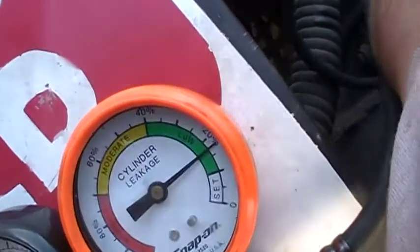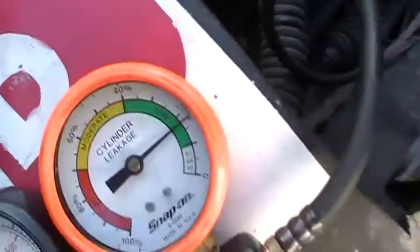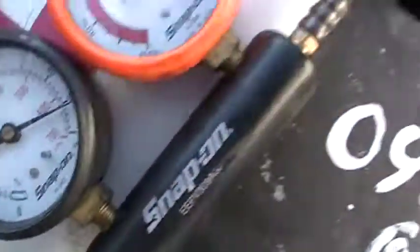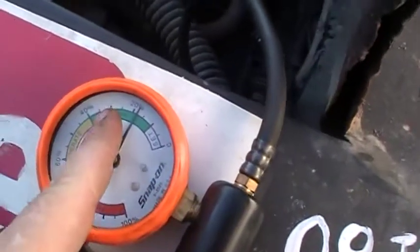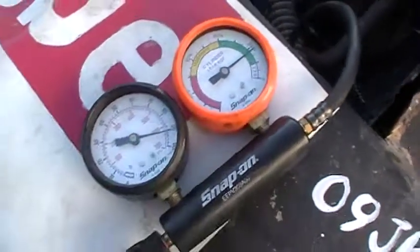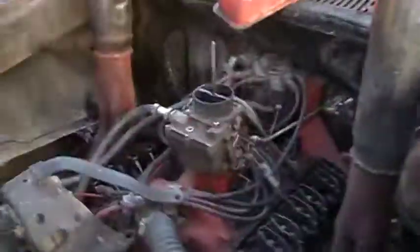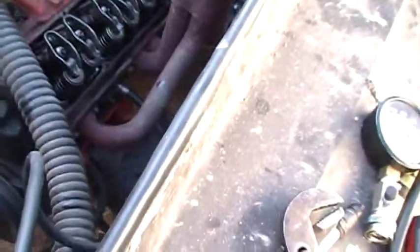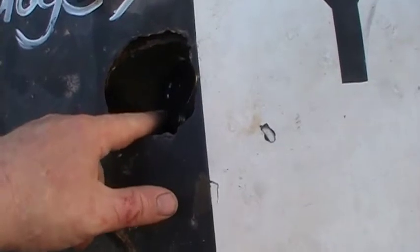Tapping the valve to see if I can lower it — looks like it's not going down anyway. They said if it doesn't go past 30%, which would be over here, you're usually fine and you don't have to worry. There you go — one simple way of testing out your engine. If you have a bad intake valve, listen to the carburetor. For a bad head gasket, you'd take your radiator cap off and look for bubbles, or if the engine is apart you can use this tester.